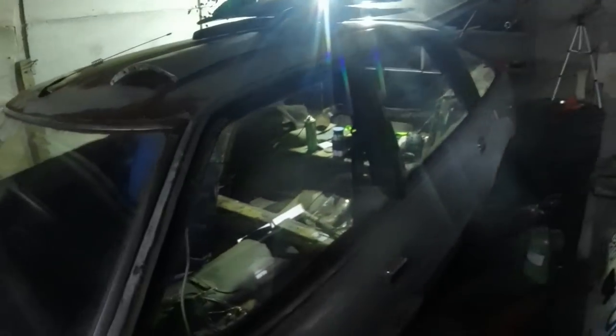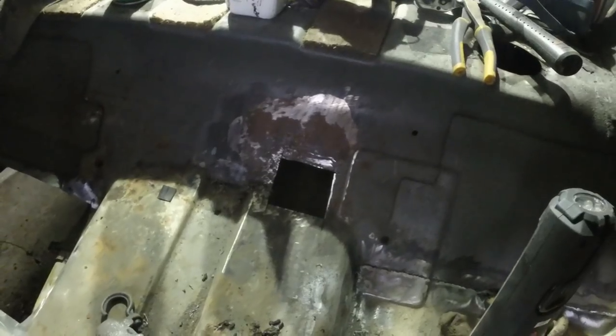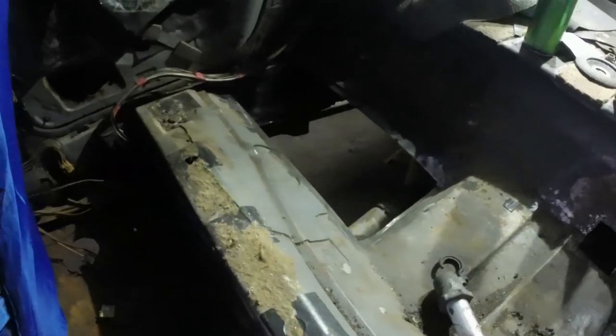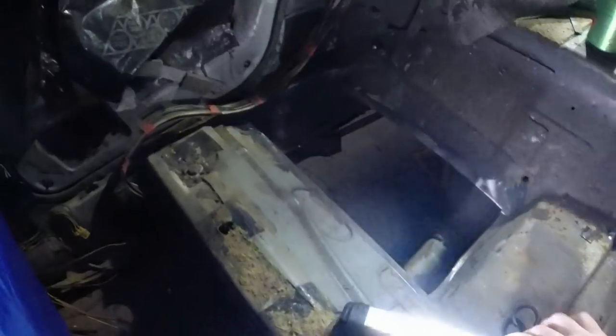And I am in the garage working again, and it's time to finish chopping out that repair section in the middle. I made the plate, but I never actually chopped out the metal that I needed gone. So I'll do that, and then while I've got the welder out, I'll weld both of those bits in together. The Hydrate 80's gone off. I'll put a bit of zinc around the aperture so that one will be nice and protected until I get back to the underside and shove it all back together.